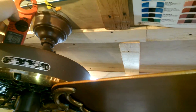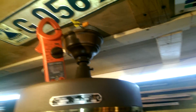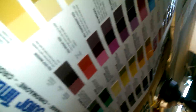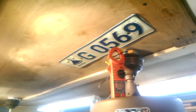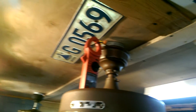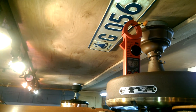Because my battery is getting low on my amp meter, I would like to demonstrate this fan — Dan Spiffy Newman style, if you will. I have a clamp-on ammeter; he usually uses an inline one. A clamp-on tends to be a little more accurate. Anyway, here it goes — first we're going to do locked rotor, which you'll see is 2.789 amps.